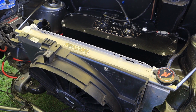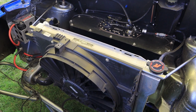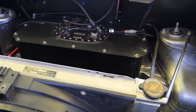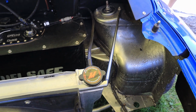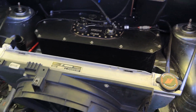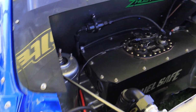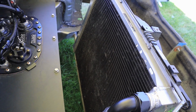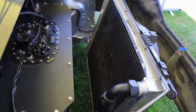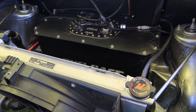A lot of the Pro Spec drift cars now that you will see will have this. There's only a few out there which are not nowadays. Sure. And then obviously this was covered across earlier, and the airflow just comes down from the roofline. Is that enough airflow to keep it cool? It works really well. On a lot of drift cars they do struggle with cooling, but this setup works really well. So we just got it right with the correct fan. It's a dual pass radiator as well, so we're getting maximum cooling out of the radiator.